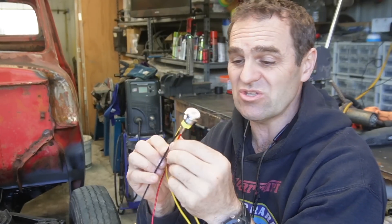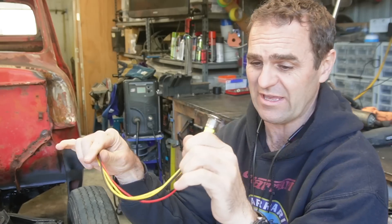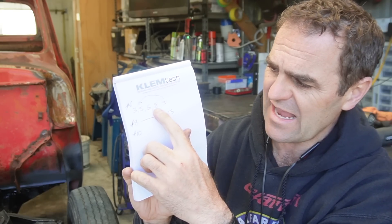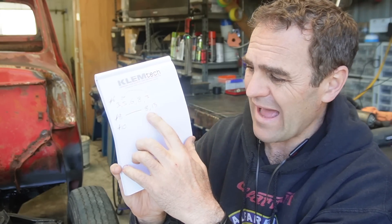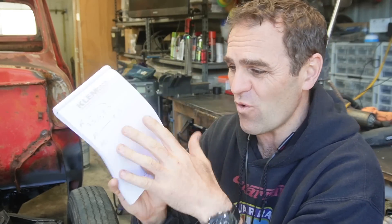I'll put a diagram up here so you can search and make your own — it is so simple, it's not even worth buying. Now I have my codes. On socket number 6 I have codes 3, 5, 6, and 8. On socket number 8 I have 8 and 13. On socket number 10 I didn't get anything. Now I'll put a link in the description to a PDF that has all of the Mercedes codes, and I need to cross-reference them with the W124 to find out what the errors are and if they mean anything.